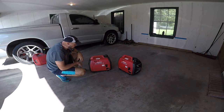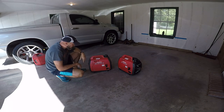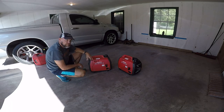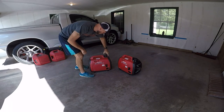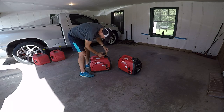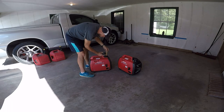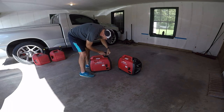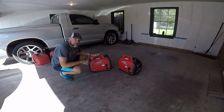It's supposed to do what that one does. I've had a little bit of experience with these things to find that sometimes when something like that happens, or when it doesn't start at all, there's crud in the fuel tank and it gets into the carburetor or in the lines going to it. Strangely, because if I recall correctly, there's a pretty significant strainer in these things, which I've never removed, to fill it. It takes a little while to fill these because of that strainer, but even with that, this thing has managed to start acting up on me.